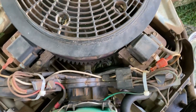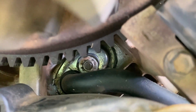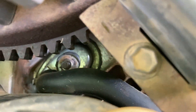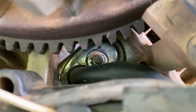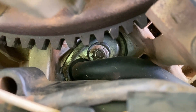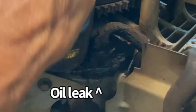Now we can finally see what we're after, which is the other end of that hose and that metal cap I showed you earlier. Looks like there's some trash down in there already. You can see that the cap has all been resealed — you can see the silicone that's been pressed out all around it and also underneath that washer. Here's a picture of what mine looked like after I removed all the big trash — an oily, disgusting mess. This is a straight-on view with the intake manifold removed, and you can see this thing has been leaking for a long time.